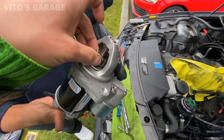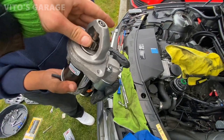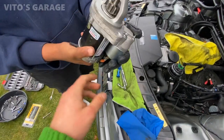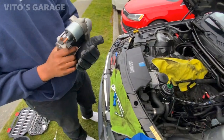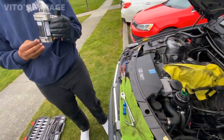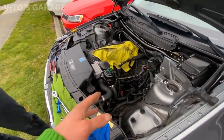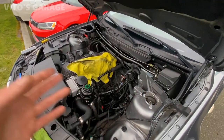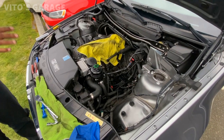That's the starter we just took off. Hold it, keep holding it. It's turning, but maybe something is messed up right here. The best thing would be to bench test it with battery cables. Or you could just install a new starter right now, reconnect the battery, and see if it cranks.